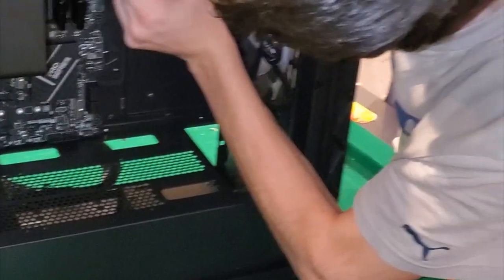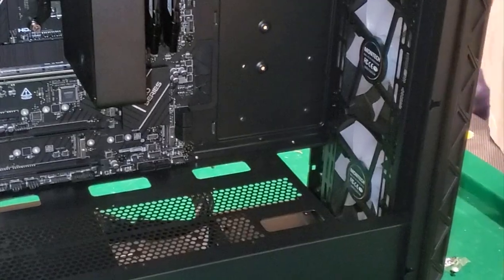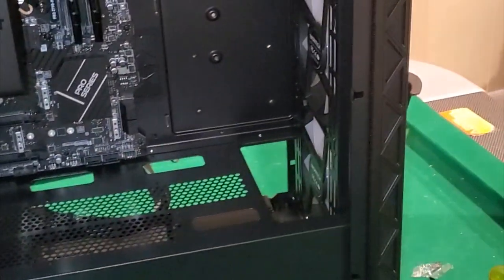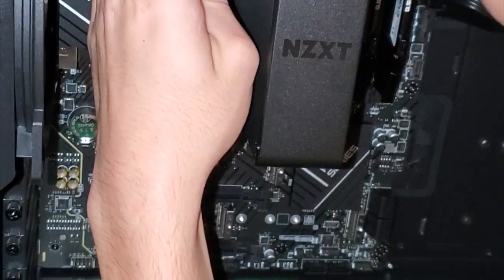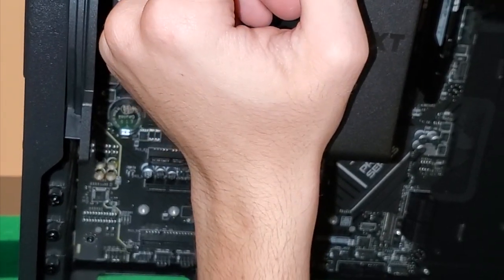This is one big PC - it's in there nicely. This is going to be my Windows 11 PC, which will replace the old i3 Windows 7 machine. We'll put the other Windows 10 there and put an i7 on top of this one. The CPU needs power - I thought it would just get it off the motherboard, but no, CPUs nowadays have their own power connector.